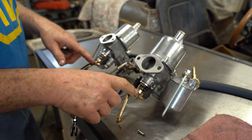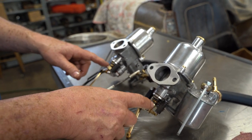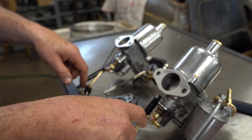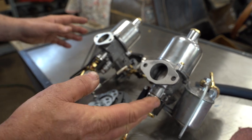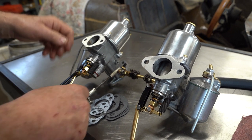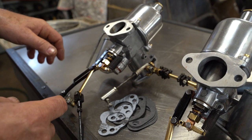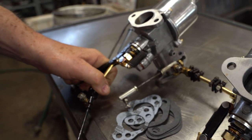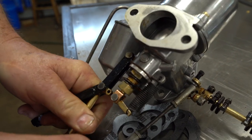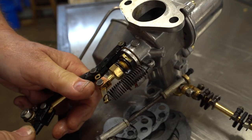When I send these out — these are for Wayne, this video is for you, Wayne — I leave the adjuster nuts three full turns, 18 flats down. There's a lot of argument about where to start, but that's where I start. You can usually start the car without the choke. If you have to, just choke one carburetor. You're working underneath the bonnet, so the starter switch is right next to you. The jet drops here — it's not a choke at all, it's a mixture control.